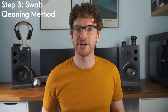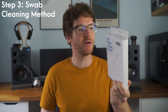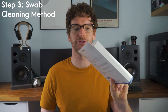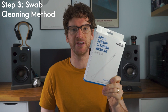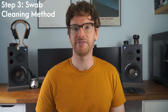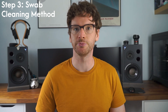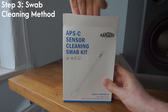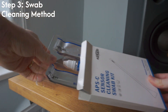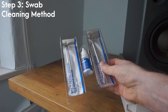The next step involves cleaning the sensor with a swab. I'm using a specialist cleaning set that I got off Amazon — fairly cheap, around 15 pounds or about 20 dollars — and it should do for a few cleans. This set has 12 cleaning swabs and the fluid you need to clean your sensor. I'll leave a link in the description to the set I've used because I found it very effective, but please double check the instructions before using it. Make sure any cleaning fluid you have is designed for sensors, as lens cleaning fluid is not suitable for sensors.